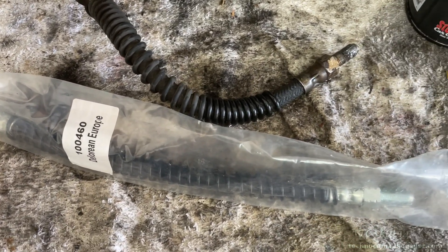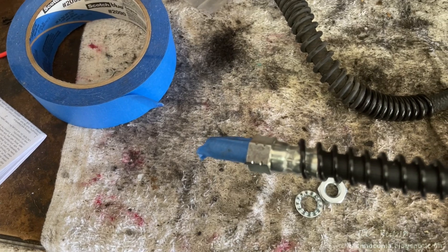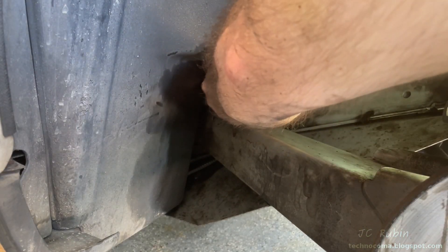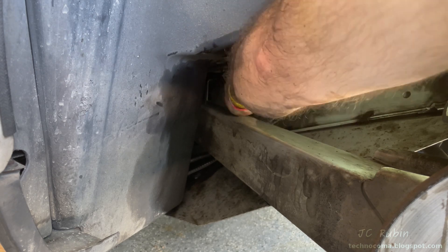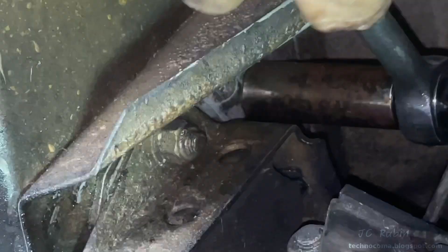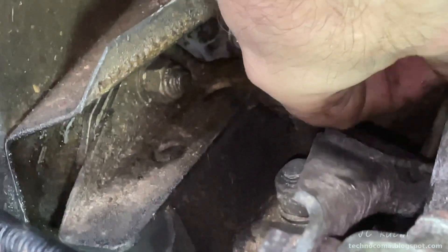Here's the old hose next to the new hose we're going to install. I feed half of the hose first into the car. I've covered one side of the hose completely with anti-seize on the flats and the first couple of threads, then push it right through into the other side of the frame, drop on the lock washer and nut, and tighten it down by hand, then finish it off with the ratchet — snug. The rigid line was held away for protection; I bring it back into position, make sure it's aimed perfectly straight, tighten it down with our wrench and snug it back down.